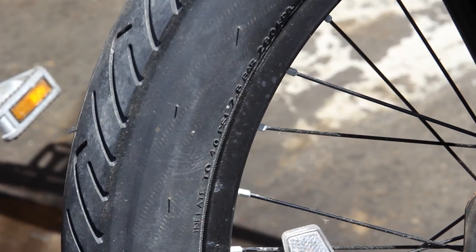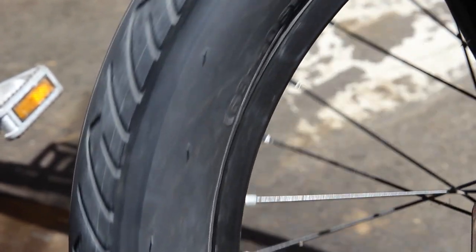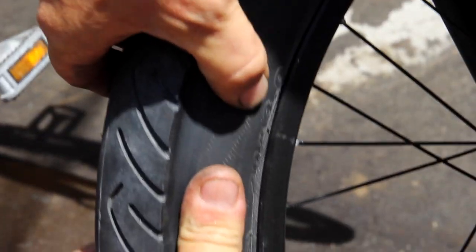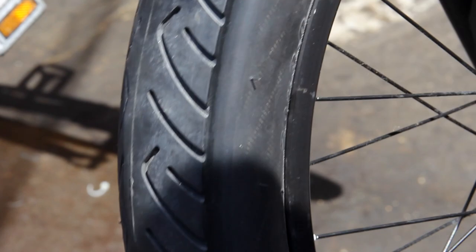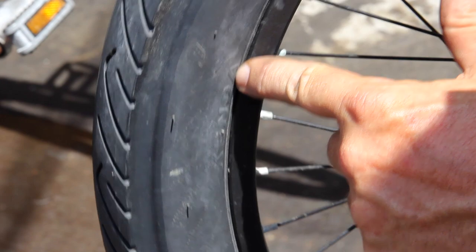I've got a little too much air in there — I can't massage that baby back in. I'm going to let a little out and go to where it's bulging and massage it — massage it right into that spot. Now I'm looking at my rim bead edge and I'm checking very carefully all the way along. Not only on this side, but you better do it on this side as well, and make sure that it's seating right.